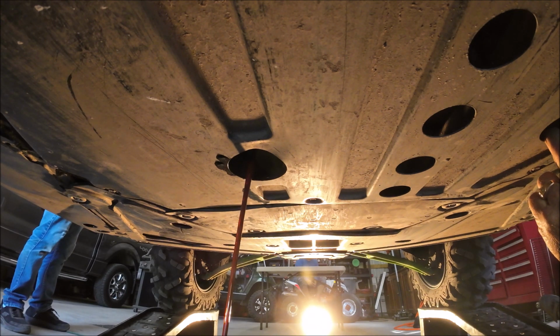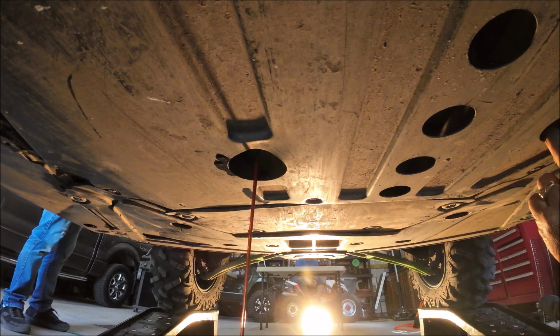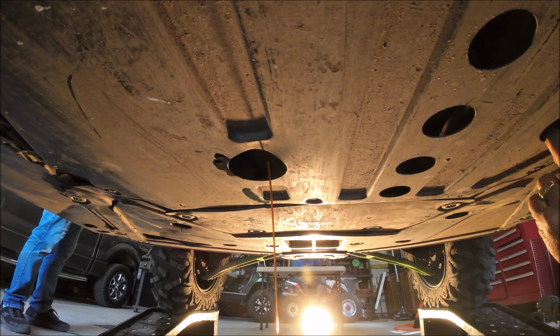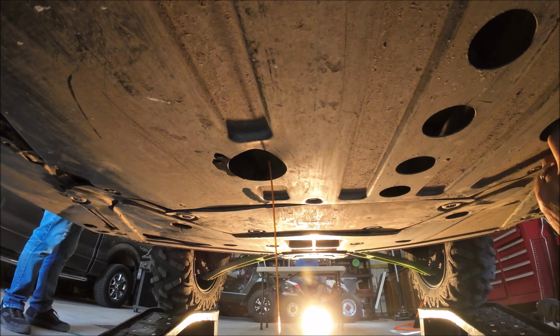That's a little more tricky because of the filter. Yeah. Well, this one was kind of tricky. I went and did some checking so I kind of knew where I was at. This has got a spring and a washer and all that stuff for the filter that you have to put back in the right way and put it back on. Yeah, because if you put it in the wrong way, it blocks the oil passage. The spring has got to go against the outer cover.